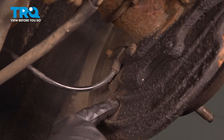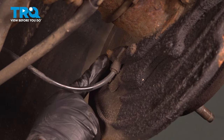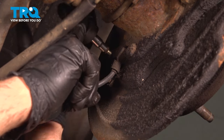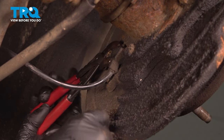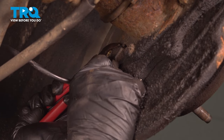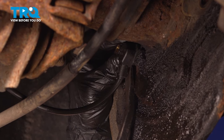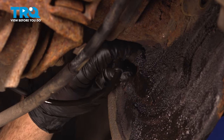On the backside of our brake dust shield, here's your ABS sensor, held in place by an inverted number 8 Torx bit. Put that socket on there and give it a few taps to remove that bolt and set it aside. Now grab the sensor with a pair of pliers and gently rock it back and forth — they are brittle and can crack, so be careful. We went ahead and soaked the sensor with some penetrant and lubricant to help work it out. Twist it back and forth and work it out.